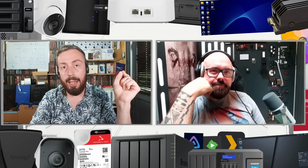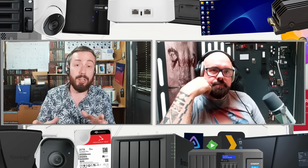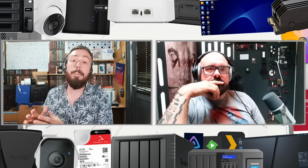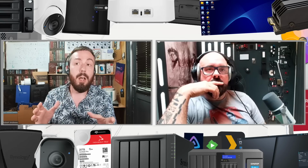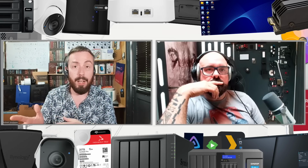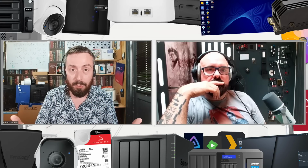And that is, in most cases, when you buy a turnkey NAS, it is built around efficiency. And that efficiency is built around so many different things. So a lot of the CPUs that are utilized are chosen based on their power efficiency to be on for days, weeks, months, years at a time. The cases themselves are designed with airflow being hugely important, be it rack mount or desktop, and power consumption over time and the impending detrimental effect of long-term use on these have to be factored in exponentially, not only because obviously it's data and it might fall over and someone will lose their data, but the last thing they want to do is keep hopping in with a new CPU because the thermal paste went dry.